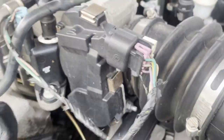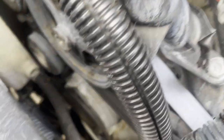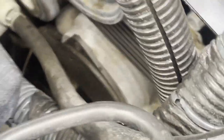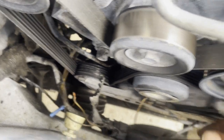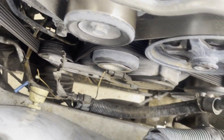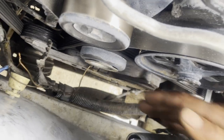These wires are looking good. It doesn't have a throttle body code on there, but someone said there was a wire they found — and yeah, I see it. There's a wire down here going to the sensor right here. This is the camshaft solenoid, so that's probably it.